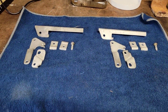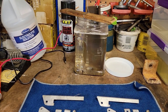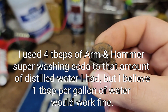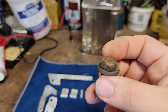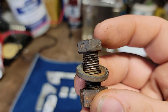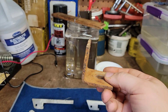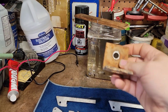This is the electroplating part. Now let's play with electrolysis — rust removal with electrolysis. I played with it for a few minutes to make sure my solution was working for electrolysis, and it does work. This was not even probably 10 minutes in that solution, and this was really, really rusted up, and the rust was just falling off of this thing without even being probably 20 minutes. This along with that bolt goes for the J-bolt mount for the spare tire bracket. So let me get this on my hanger right there and show you what it looks like.